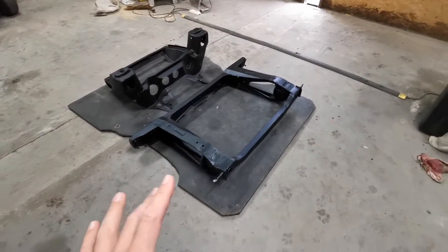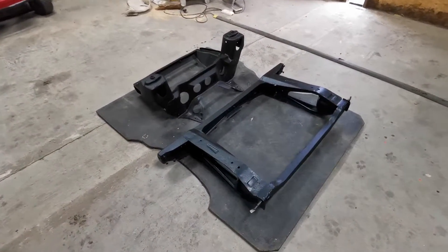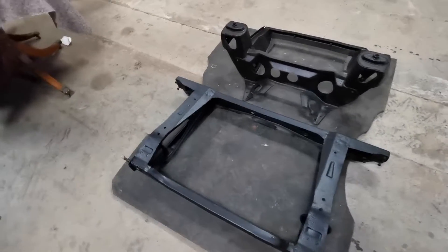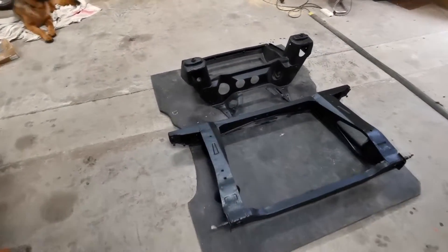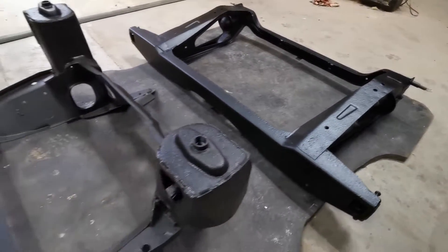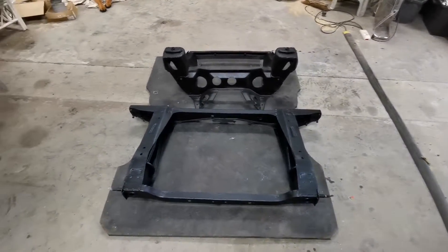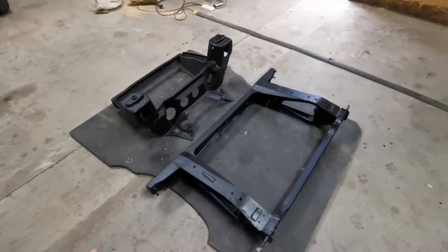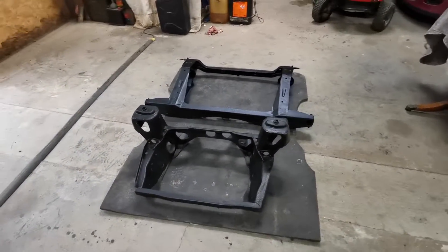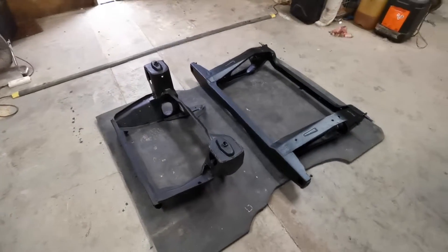Right guys, so that's it, they are the subframes finished. It's not the finish I had in mind — I wanted a nice smooth gloss black courtesy of the powder coater, but of course that hasn't happened. In the interest of just getting things done, I've done it myself. You've seen the process they've been through: they've been taken back to bare metal, they've had an inhibitor put on them, they've had etch priming, and then they've had several coats of stone chip. The finish isn't what I had in mind originally, but I'm pretty happy with how it's gone down. This mini isn't going to be a concourse example up on mirrors at a show — I just want it to be fully treated, rust proofed and future proof, and I think this solution is going to sort that. They're going to be safe, they're not going to rust. Next time, hopefully you're going to see me rebuilding these subframes with some aftermarket parts, which will look pretty cool as well as helping the car to handle and perform better.